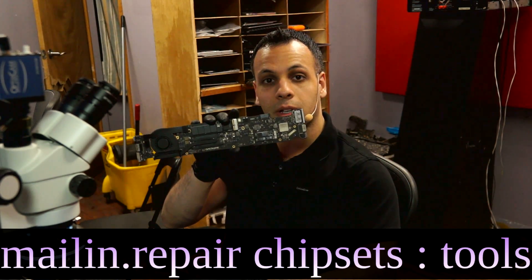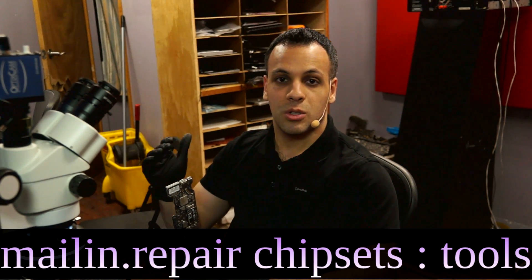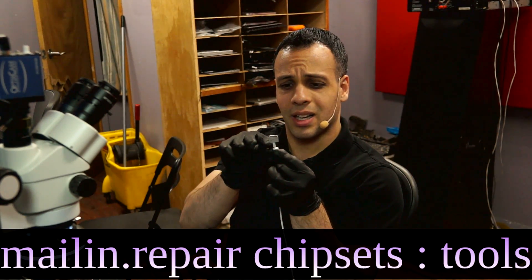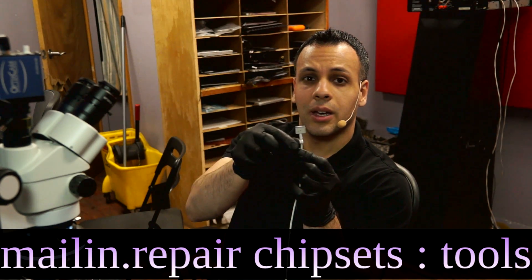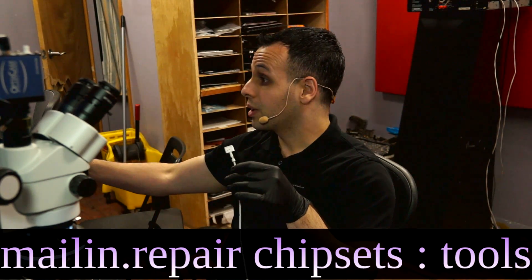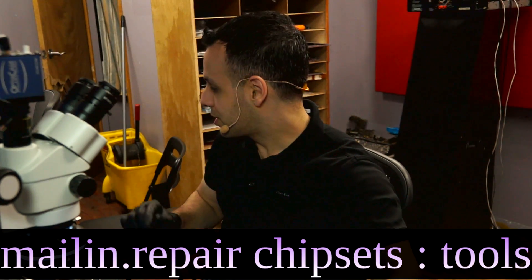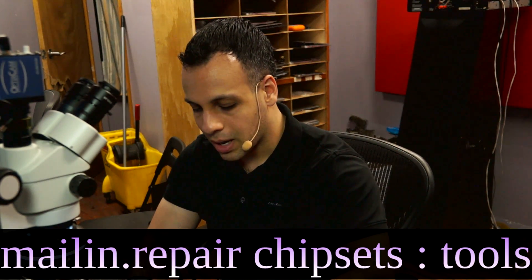Today I'm going to be going over a common problem on MacBook Airs, which is that on a DC power supply, when you plug it in, it's only pulling between 2 to 250 milliamps. I take these MagSafe adapters — I always start with an 85 watt because I want the tip to tell the computer that it's 85 watt in case I'm plugging it into a Pro. I snip the tip off and then plug it into a DC power supply. This way I'm not always going through adapters and killing them, and I also get to see exactly how much power is being drawn from the DC power supply.